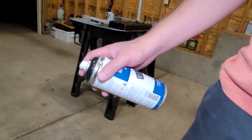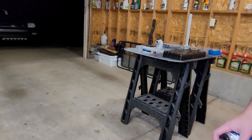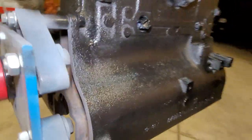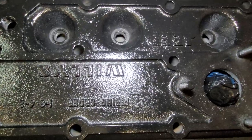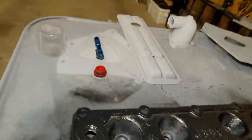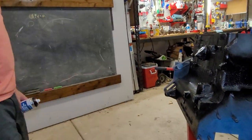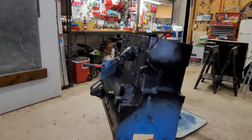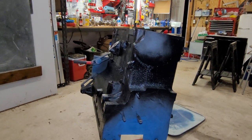This stuff sticks very well and stays stuck. And if you do scratch it, it doesn't flake off like the other stuff — you just get a little ding or nick that nobody would notice. I got the head painted over here too — same story on the head. You want to make sure you put a piece of tape in that water inlet so you don't get black paint on the interior, because you don't want anything affecting your heat transfer. We're waiting on one stud to come in that we ordered, and once that's in we should be putting this thing back together. That's the Willys Go Devil engine with a coat of Eastwood primer and a coat of Eastwood black high-gloss paint. Sharp-looking block. Thanks guys, see you later.